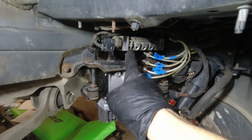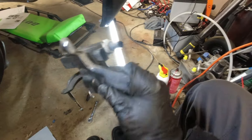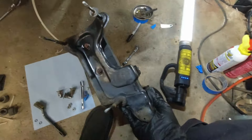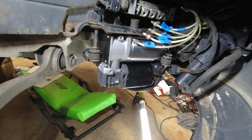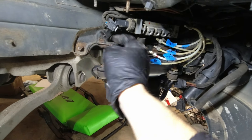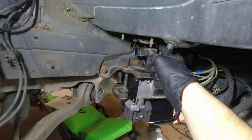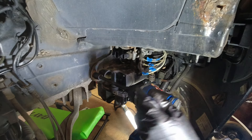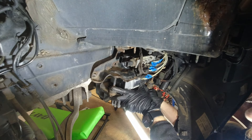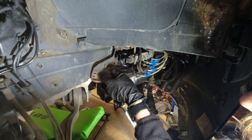So I'm actually going to replace this valve block, and while I'm here I'm also going to replace this bracket because I have a brand new one — well, I went to another junkyard and sourced this piece, and it has the valves on it. Last time I removed the compressor first and that was kind of a pain. What I've done here is removed the connectors to the valve block, the connectors to the compressor, and I'm just going to unbolt it from here with the nut here, the bolt there, and the other bolt up top. I didn't disconnect the airline from the compressor — the intake — so we'll take that out too. Then pull this assembly out.